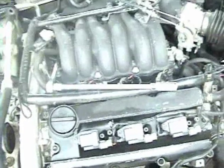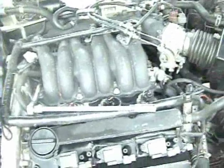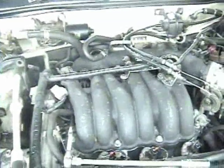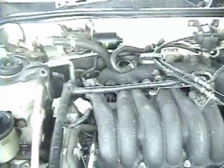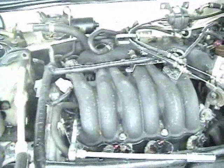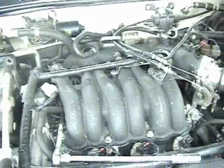And yeah, that's all you need. A 6 or 9-inch extension, your ratchet, and a 5/8 spark plug socket, and an 8mm nut driver, or 5/16, or whatever. You can't even see that. And preferably a magnet too. And of course your spark plug gapper and your torque wrench, preferably, but it's not a necessary item. Yep.